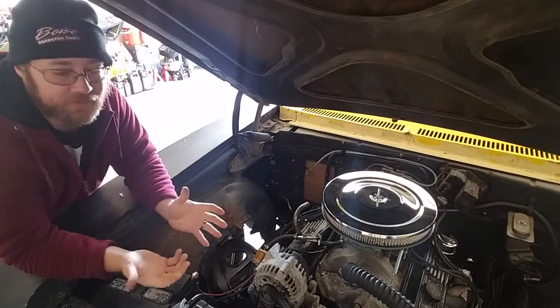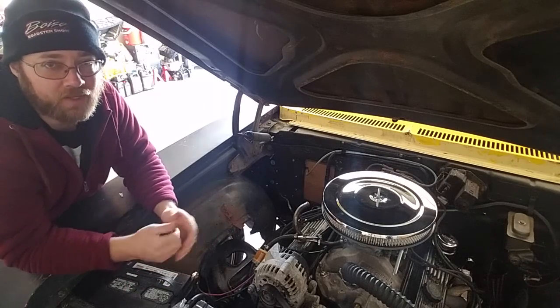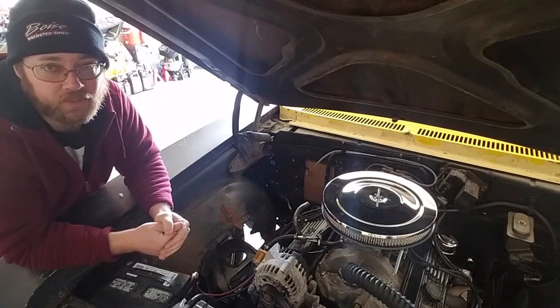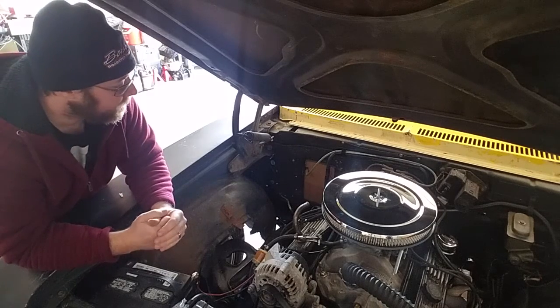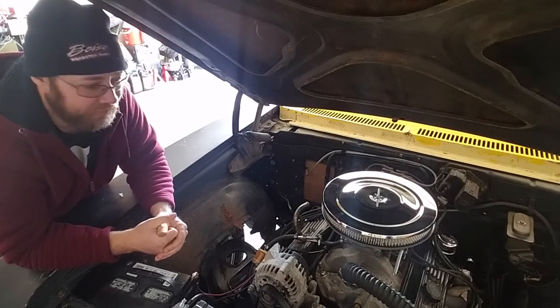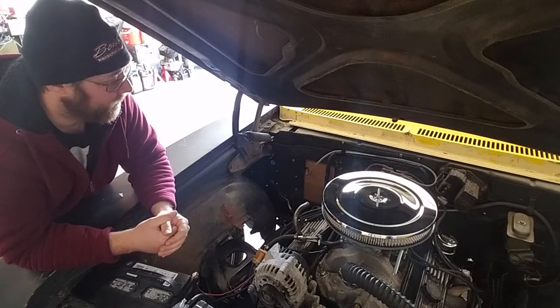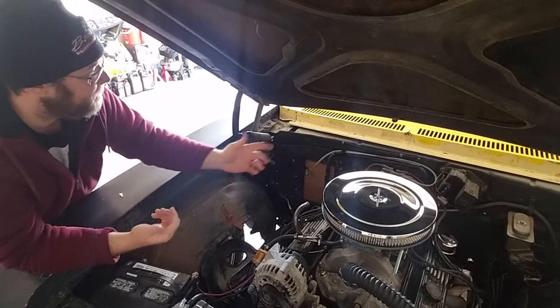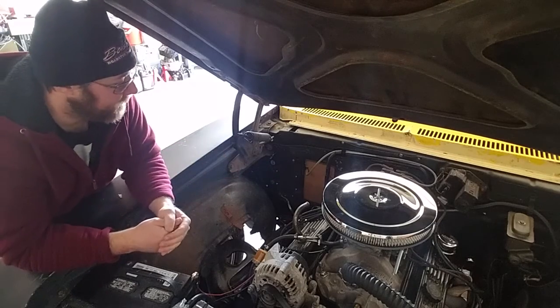But pretty sure mine was just a clogged vent tube. So if you're having some kind of problem like that, get under there and clean that out, or make sure that hole isn't plugged up with something. But I mean, it didn't run hot, it shifted fine. It drove good. It wasn't slipping or doing anything weird. It just was seeping fluid out of it.